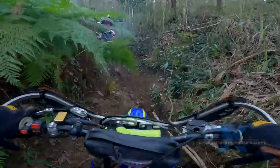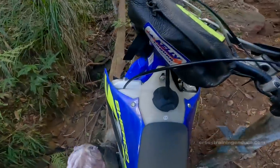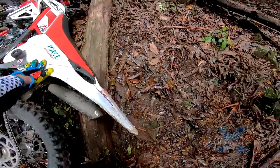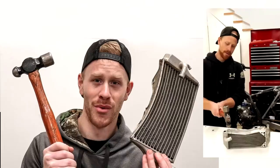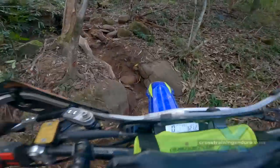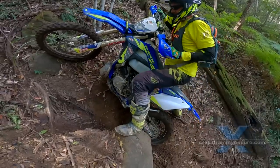Are you happy to fix things yourself? Some riders spend a lot of money on heavy guards for two stroke exhaust pipes, but for half the price you can buy a repair kit that uses air pressure or water pressure to fix your bent pipe. The same with radiator guards — an alternative is to just carry some JB Weld in your tool kit to plug any leaks, and when you get home, straighten your radiator again. Ditto with crankcase protectors: if you carry JB Weld in your tool kit, you can usually do a repair job that will get you home again.